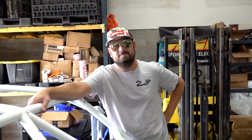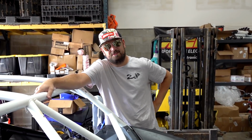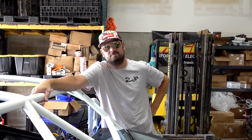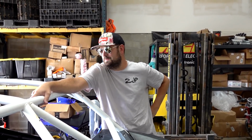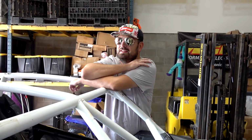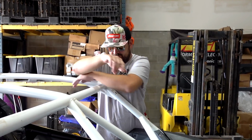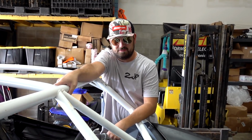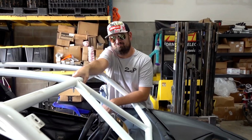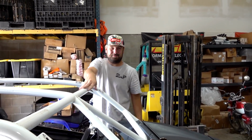All right, that's good. So we need to do a little work to find the rest of our boost here? I think we just need to adjust up the wastegate actuator. Just crank it to the max? I mean, we need probably like 20, at least 10 more pounds of boost. If we put crack pressure at 20, I think that's where it was before. They recommended a lot of things. We didn't take any of the recommendations into account. Not how it works around here. But I think we should look at fueling on the AEM, figure out where we're at there. I can mess with the actuator. All right, sounds good. I'll pull logs, crank that actuator up.